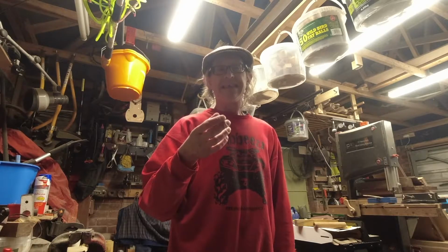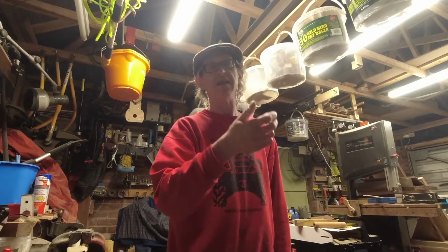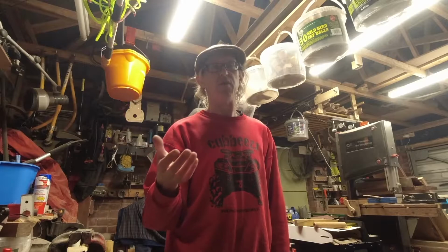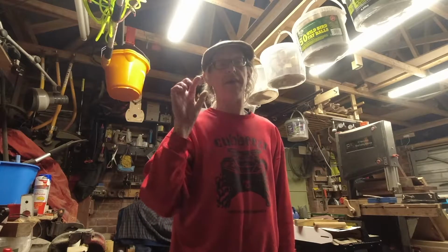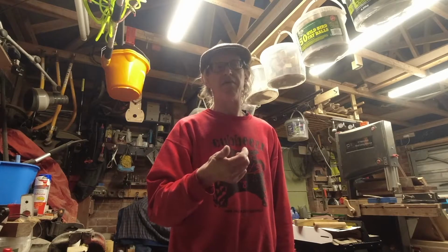It's a step spacer and it's meant to have the small diameter against the conical washer and the big diameter against the basket. Well, somebody in their infinite wisdom had reversed it, put the small diameter up inside the basket. So I rectified that problem.